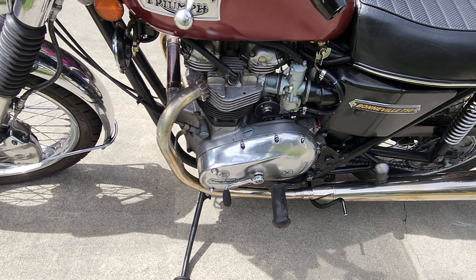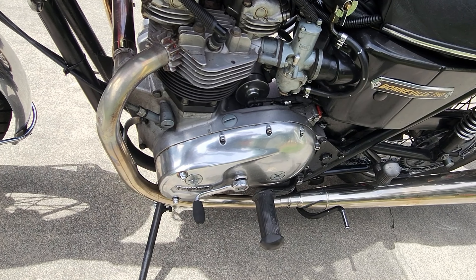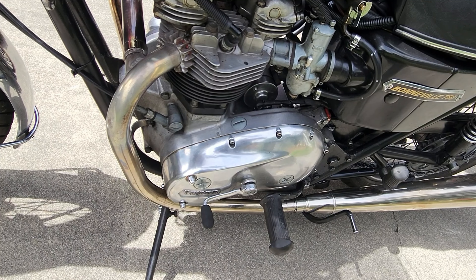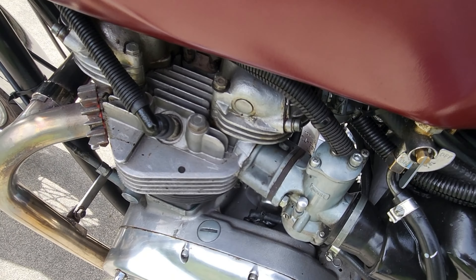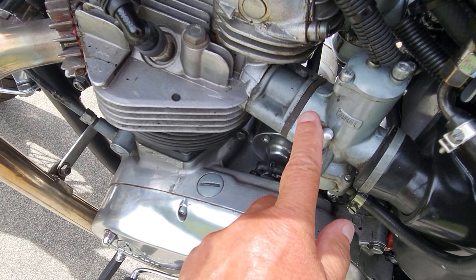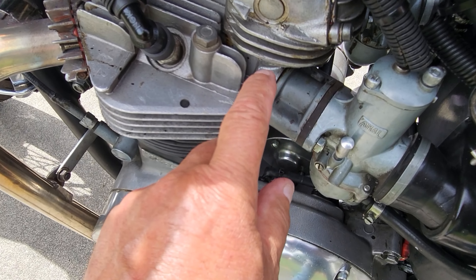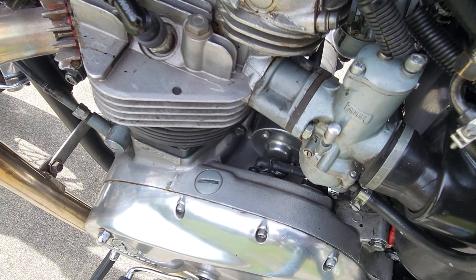On the engine I've polished the exhaust manifold and matched the silencer headers to the manifold on the exhaust side. On the inlet side I've matched the carburettor to the manifolds so there are no sharp edges or rough parts sticking up, and I've also roughed up the inside to improve the vapour mixture.